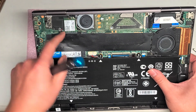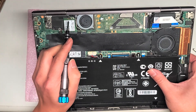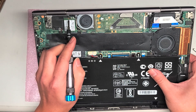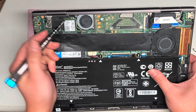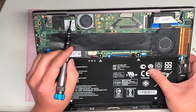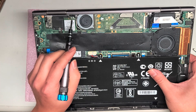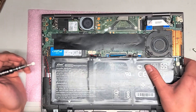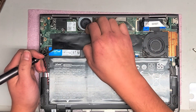There's another speaker connector here — also pops up. The wireless card is here and uses a PH0 or JIS0 screwdriver. The antennas you pull up from the tails as well. If you want to see how to remove these, almost all my other videos show the removal process in more detail. You can look for one that's a complete disassembly.